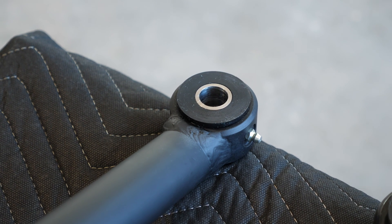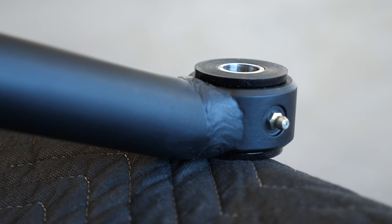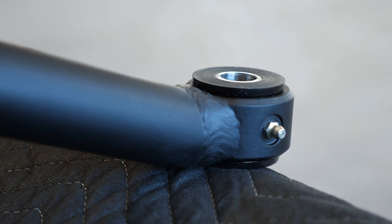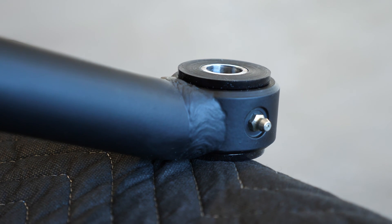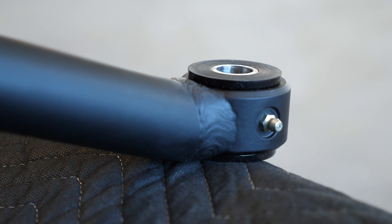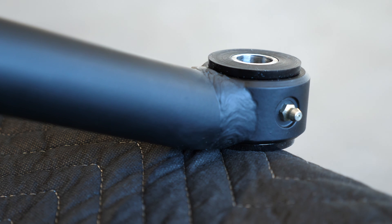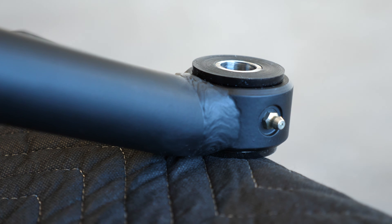It is very tight when new and installed, but you just keep pumping grease through it and wait for it to break in. The bushing housing is machined in-house out of 2-1/4" OD, 3/8" wall 1026 DOM tube, welded to the main tube, which is 1-1/2" OD, 3/8" wall. The tubes are laser cut and coped on a machine pre-welding, so these welds are extremely durable — there are about 2, maybe even 3 passes in some places. Super durable.